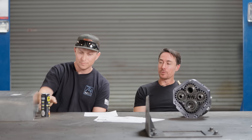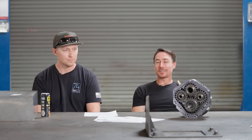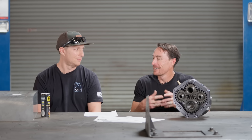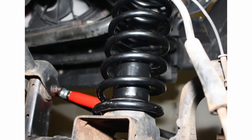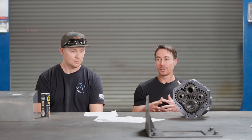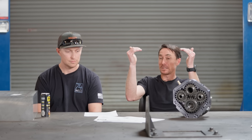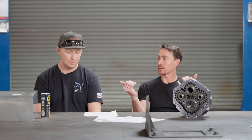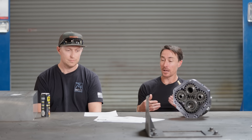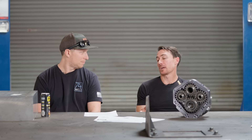There's a misconception that when you go to a lift kit you're automatically getting more travel. The vast majority of lift kits include a bump stop spacer to lower your bump stop down. When guys say 'I get so much more travel because I put a four-inch lift on,' you're not really getting more travel — your bump stop or full jounce went down the same amount. Your up travel is the same; it's just now all your suspension geometry has been altered from factory.